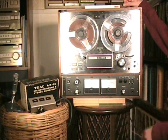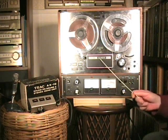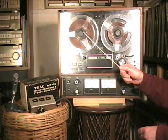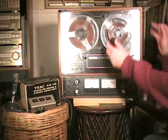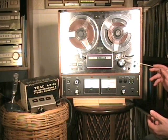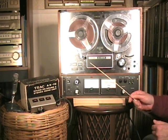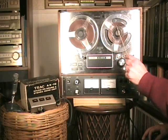Up here we see a button for the tape tension switch. It's set for half mil or one mil thick tape. The tape I'm using here is vintage Scotch recording tape from the same time period as this machine. I bought this machine in 1972 with all the accessories. The reels are held in place by these little rubber doogers — you pull them off and they have a hole which grips the shaft of the spindle and presses the tape down against the tape table. The capstan is interesting because it is a rough surface capstan, which provides a tremendous amount of grip and accounts for a great deal of the speed accuracy this machine is well known for. There are four heads in this machine, which we will see later on in Episode 2, along with how the motor drives the capstan and how the feed reel and the take-up reel work.